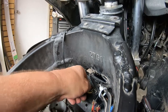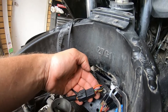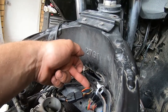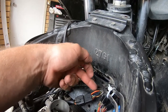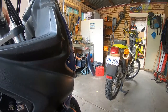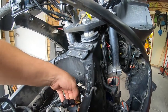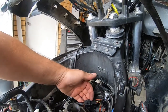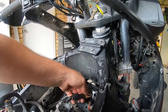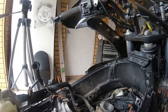The orange and red-stripe wire — power comes from here — it's going through to switch up to your starter. I'm going to test it again before I put it back together. She is working. Wiggling her — my guess is that connection just was not in there properly. Somehow I fixed it, so now I've got the job of putting this back together.